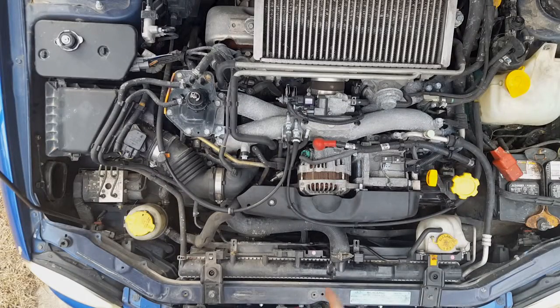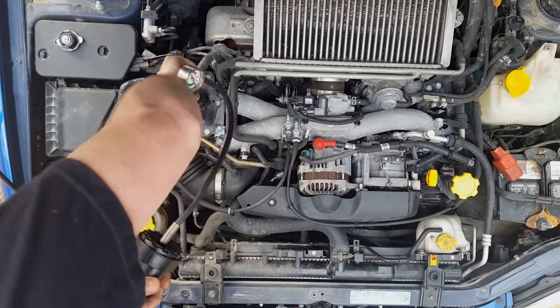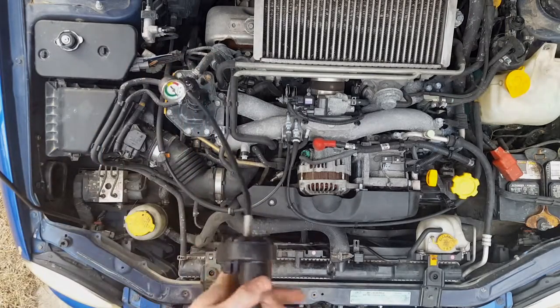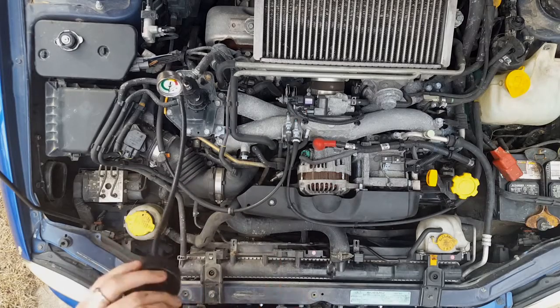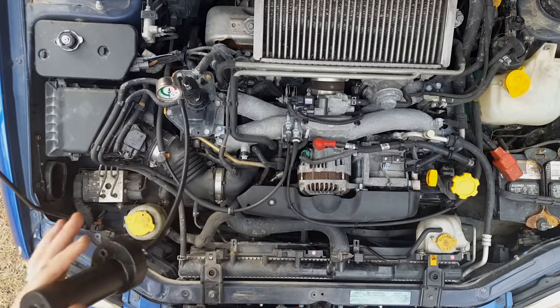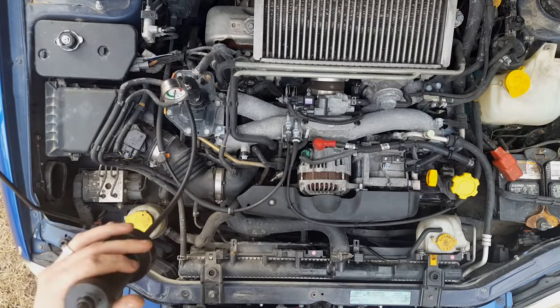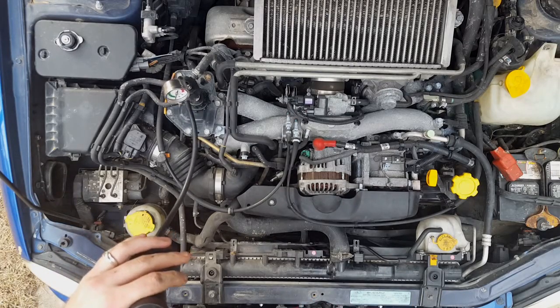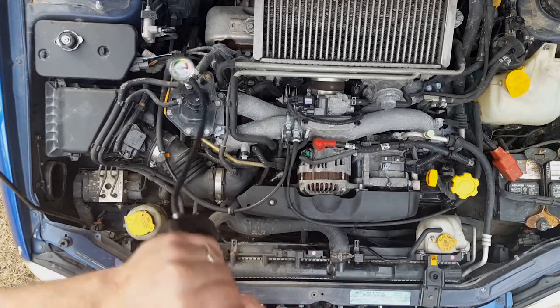What we've done is remove the front portion of the intake system and put the appropriate cap on the upper reservoir. Now we're using our pump with a gauge on it to pressurize the system. What this is doing is simulating your vehicle being hot — as the coolant gets hot the system expands. That pressure is what's going to cause your system to leak while you're driving. This allows us to check while the car is cool.